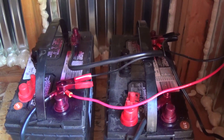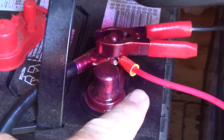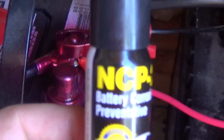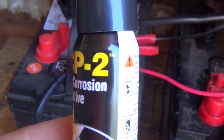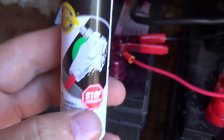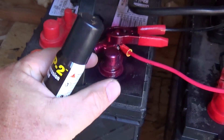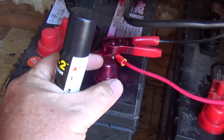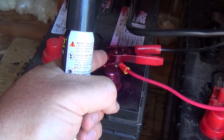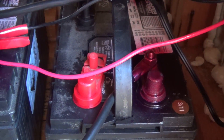Just to let you know what I've got here - also with these batteries, I put on some of this red stuff. As you can tell, it all looks like it's painted red. This is called a battery corrosion preventer. It comes in a little package at the auto mechanic store, Walmart, wherever. It also comes with little pads that you normally put on here and then your terminal on top. But since we're using the bolt section, I just covered it with this stuff so it doesn't corrode. I did that on all of them so I should not have any corrosion at all.